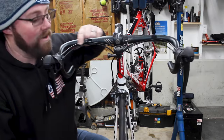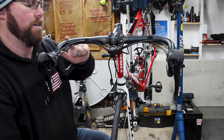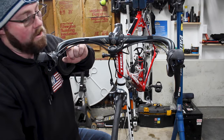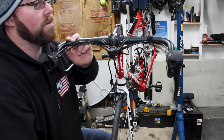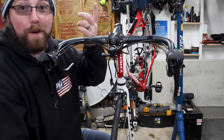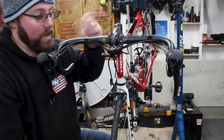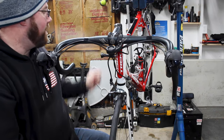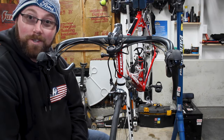From there, you can see what I did with the brake cable here. You're going to pull these cables to about where you want them and then tape them to the bar. I generally do about two or three spots of electrical tape — that way the cables stay against the bar when you wrap so they're not waving around everywhere. Electrical tape works pretty good. Do that, get your derailleurs adjusted, and you have new brifters installed on your bike.